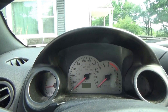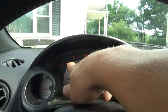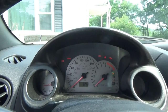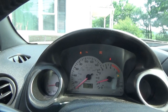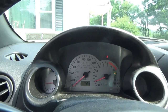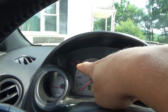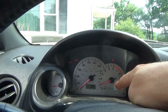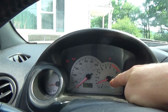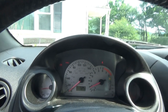What I saw was the brake and the positive battery light were flickering and then it stalled out. Want to reproduce it — right there, see that? Brake and alternator lights come on. It's not happy.